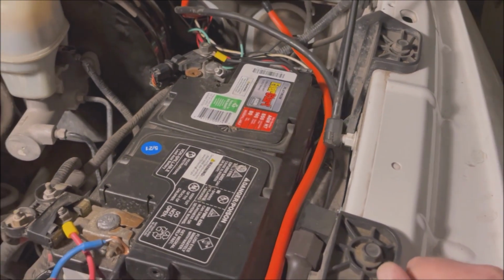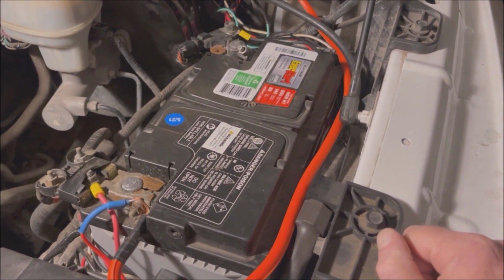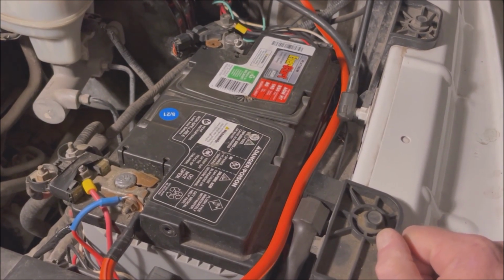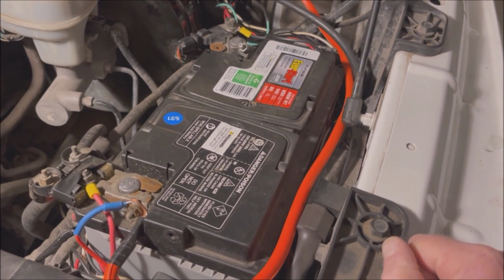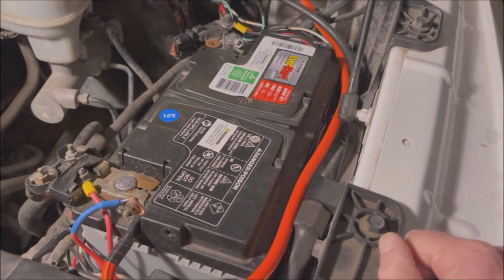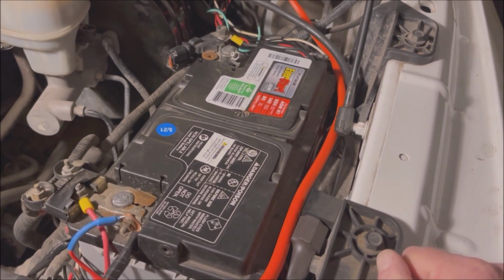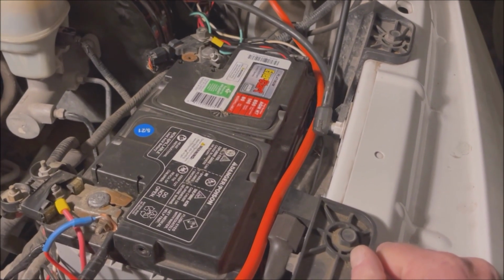Also, anything you can, put a fuse link in between at least so that you have plenty of spots for it to just completely shut down. And that includes from the inverter to the switch and the switch to the plug, and that I did in here and everything. I've already tested it. It works perfect. All the connections are good. There were no sparks when I hooked up the positive or the negative.